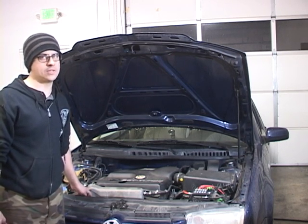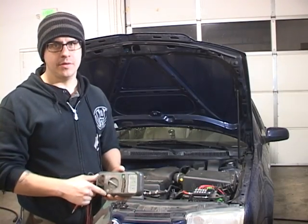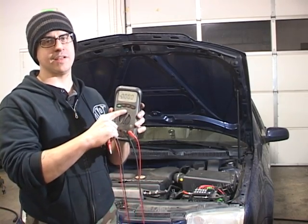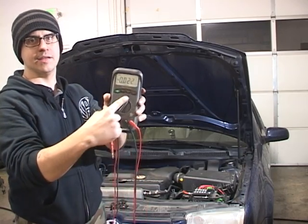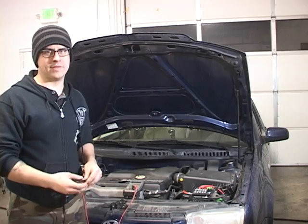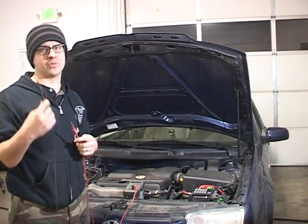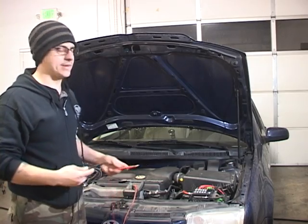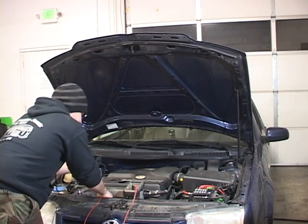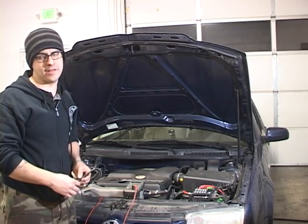The first thing you're going to want to do is start the vehicle so we can use a voltmeter to check how much voltage the alternator is putting out. Take your voltmeter and set it on DC voltage. The universal symbol for DC voltage is a straight line with a dotted line underneath it, indicating that the voltage only goes one way. Take one of your meter leads and touch it to the large wire at the back of the alternator. If you can get the lead positioned in there just right, it will prevent you from having to hold the lead in place while you make these tests.